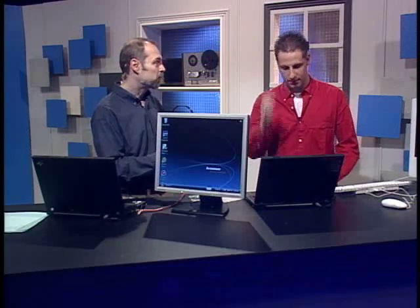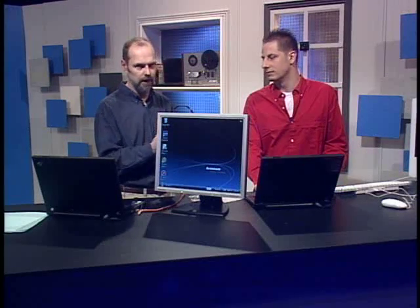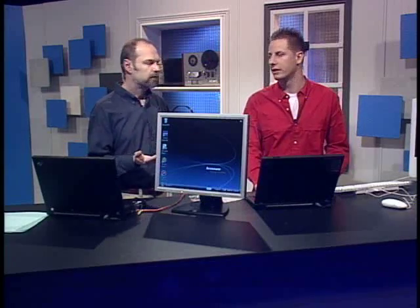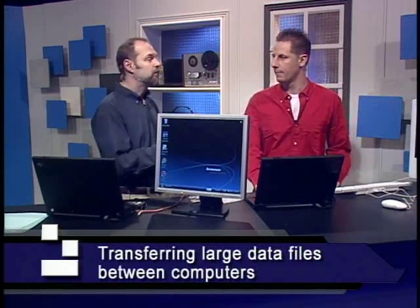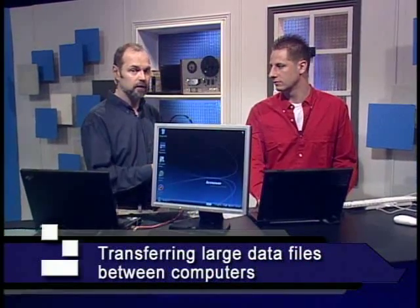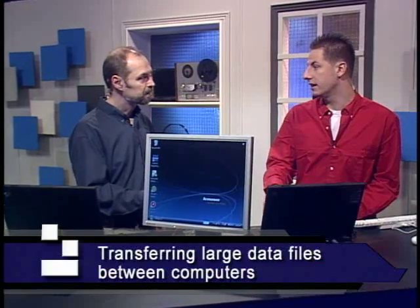One of the key things you might want to do is go Mac to Mac first because that's the simplest one. If you use a FireWire cable — a six-pin FireWire cable, that's the bigger one — it's standard for hard drives. If you buy an external FireWire hard drive, it's going to use that kind of cable. Plug it into the back of the Mac and into the laptop. Boot the second computer you want to get stuff off of — it's shut down, you plug it in with FireWire, start it up, and hold down the T key. On some models it's Apple-T, others just T.